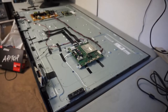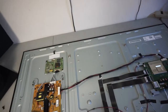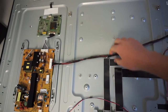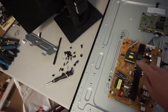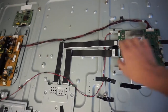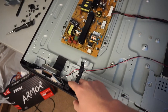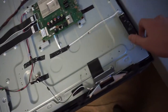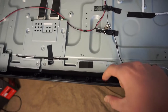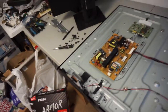So now we can see the innards. The cable management isn't as nice as it was when I first took this TV apart. But basically we have the power supply, LED driver, the main board, the T-Con board, and then a few other items we want to take — like the speakers, the little board right here with the buttons on it. There's also an IR receiver down there for the remote. Let me set the camera up and I'll take a more in-depth look at all of these parts.